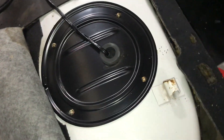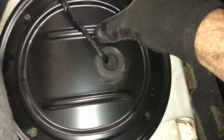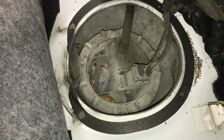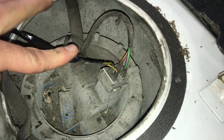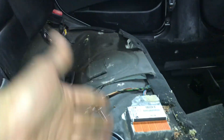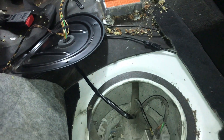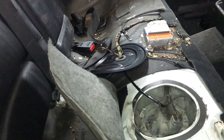Now it's time to look at the in-tank fuel pump — here it is. Let's get this thing unscrewed. There we go — we're going to take that out and replace it. What I've identified: this is a fuel tank level sensor, and this is the pump here. The pump is typically identified with a green and violet stripe, then a brown stripe — that's the universal code for fuel pump. There's also another fuel tank sensor on the other side because the tank straddles the driveshaft, so it needs a sensor on both sides to know the real fuel level. There's also a fuel tank pressure sensor behind the wheel well that we need to replace with the E92 one so it's recognized by the new E92 N54 computer for emissions.